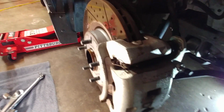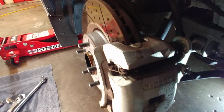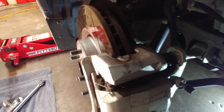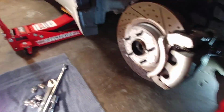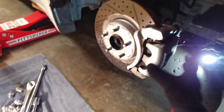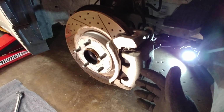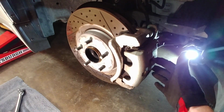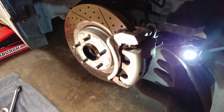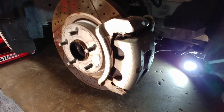And then to remove these, it's just, I think, 1, 2 on the back, the bigger bolts, and they are a little bit larger. I'll have to get what size those are, but you can figure that out. Then you take those out, and this whole brake will come up, and you can flip out your pads. These are not the big brakes, so there are two pistons over here forcing against a flat face. The advantage of the bigger brakes is there are 2 pistons over here and 2 pistons over here, and they squeeze together, where this is squeezing from the side to a face. That's one of the major differences of the big brakes versus the small brakes.